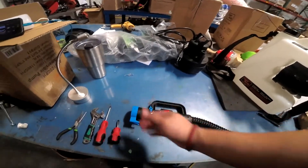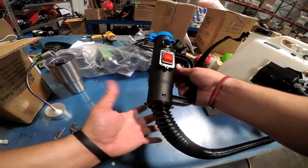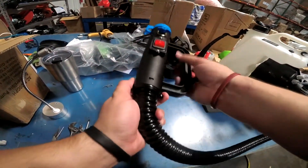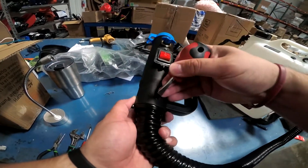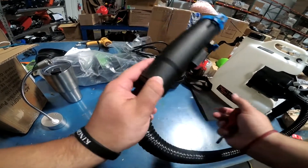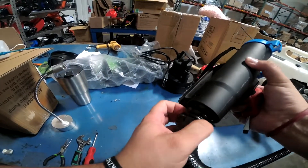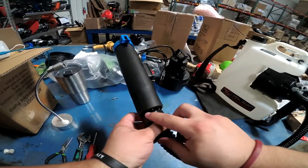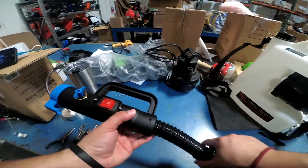You're going to go from right to left. Take your flathead and push this side in, put your fingers on these little tabs for leverage, push this in just like so, and then hold it out. Then push the other side. Don't just do one side and pull it out because you can break these tabs — once you break these tabs, it's going to stop the seal.